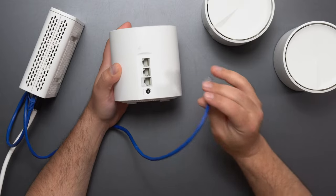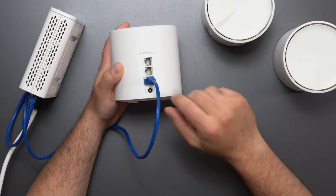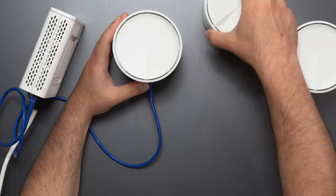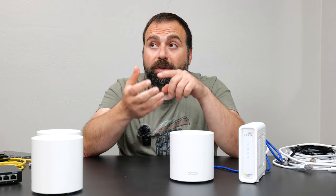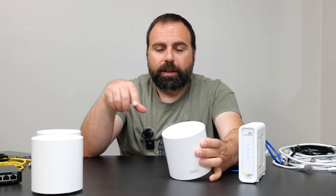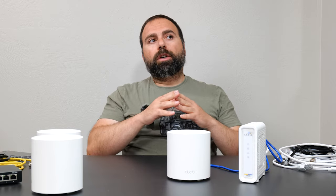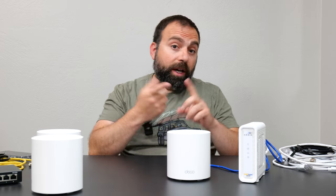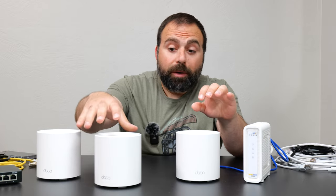Just as a heads up. In this case, to keep things simple, I'll connect to the 2.5 gigabit port. For this demonstration, I'm omitting power, but everything needs power — keep that in mind. Once you connect, you open the Deco app, which will guide you: turn off your modem, wait two minutes, power back on, and once all the lights are on, connect the device, click next, and pick your Wi-Fi name and password. You can use your existing router's Wi-Fi name and password so all your devices automatically connect. Keep in mind the SSID and password are both case sensitive.